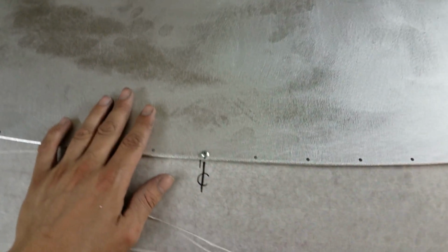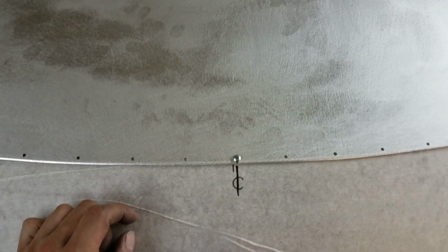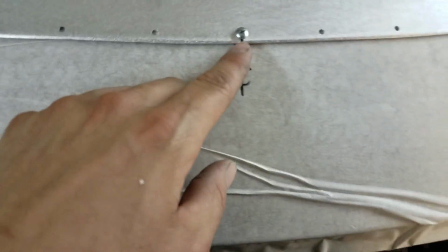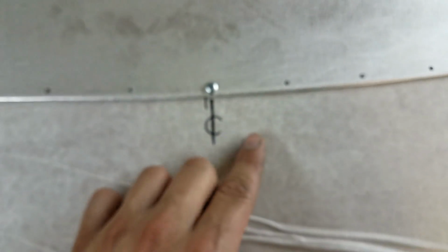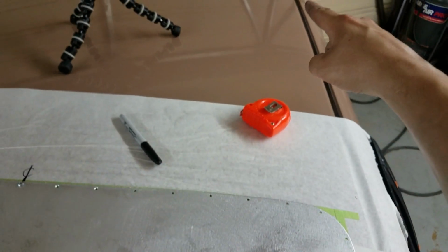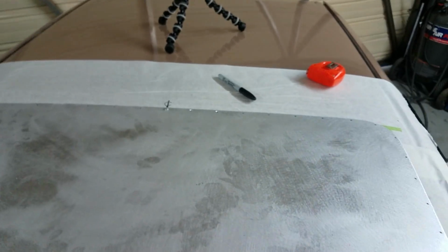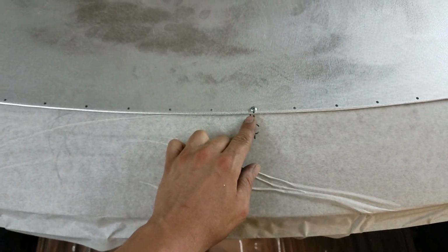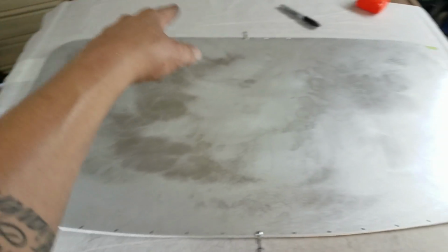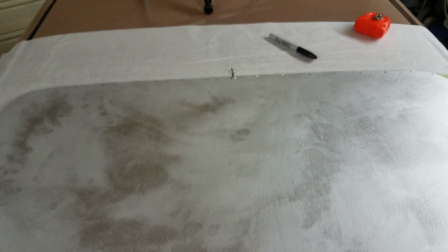Alright, guys, so after I sanded it, I actually ended up sanding my center mark off. So I was like, oh, what the hell. But I remeasured it, and these two holes, I drilled dead center. So I measured it and I checked it. This was the center of the panel and I marked it, but you can't really see it now with the screw in there. I lined that up to the center mark where I measured, and I centered it on the hatch left to right so that I know the center of my panel is in the center of the car. And of course I double checked it with the tape measure, and once again I measured from the back side of this all the way to the back of the hatch on both sides to make sure it's nice and even and everything's straight. So I drilled the first two holes right in the center. I put a screw here and I put a screw here. So now I know that my panel's not gonna move around. So we can go ahead and drill all the rest of the holes out, and we know it's not gonna move on us. So let's get it done.